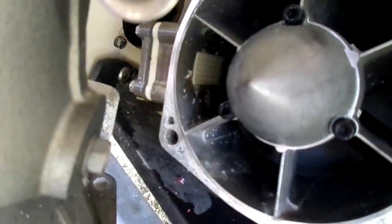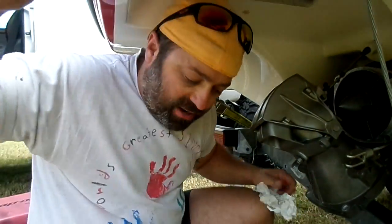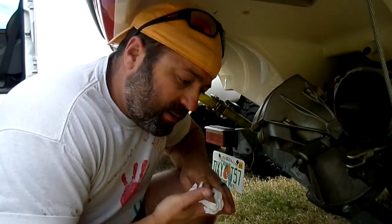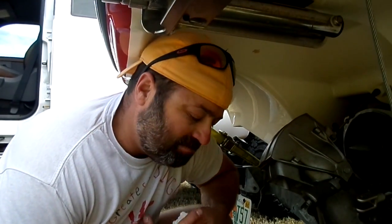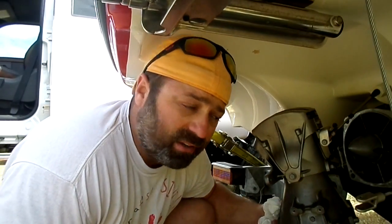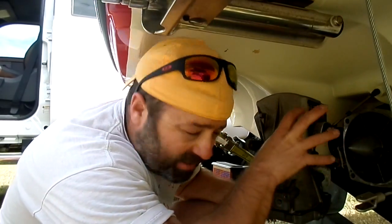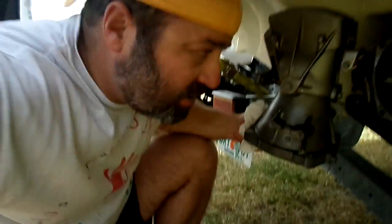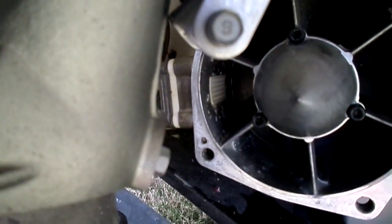Okay? So, I've noticed a few times here in Florida where we'll be cruising along and then we'll stop. The last time it happened, we ran into a big school of dolphins, so we stopped to watch them. Well, maybe 45 seconds later, my hot engine alarm just starts screaming. I was like, what the heck? So I did some research, and it was really clear water. So I jumped in the water to see what was going on, and this thing was filled with seaweed. Not damaging at all, but that little white grate was just covered in seaweed.